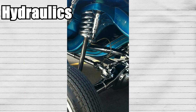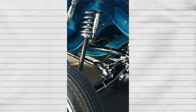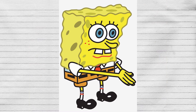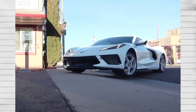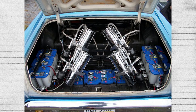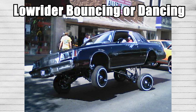Another adjustable suspension setup is hydraulics. Based on its name, you can imagine it uses some kind of liquid — in this specific instance, it uses oil to help lift the car up and down and pressurize it. It needs a compressor, an actuator, and a reservoir, so this isn't something you can buy as a standalone system. It does need a lot of supporting mods. The real reason you want hydraulics is one of two reasons: to quickly raise and lift a car over obstacles — for example, front-end lifts like the one in the C8 Corvette, the Ford GT's whole car lift, or the Lamborghini Huracán's front-end lift — or the second reason is to style on people at your local meet and just start dancing your automobile.